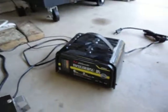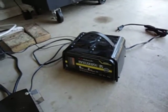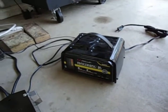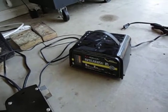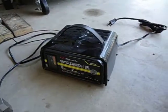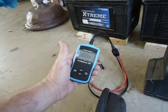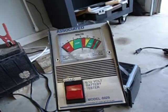This is your old school battery charger — not a smart or dumb charger. When you plug it in it's going to charge, but it will not charge an ultra low voltage battery. It just won't do anything. And it will also overcharge very easily because it never turns off. So you've got smart charger, dumb charger, smart battery tester, dumb battery tester — the old school one works with any battery condition.